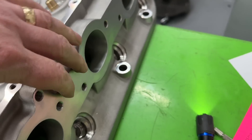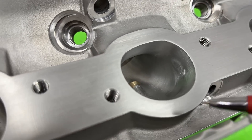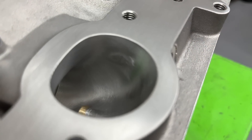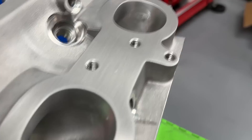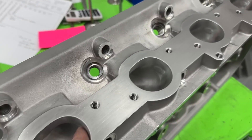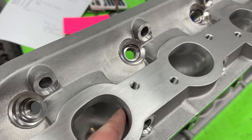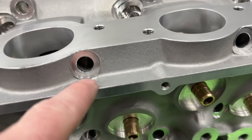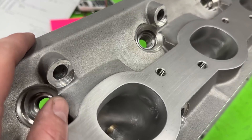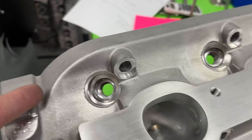The same thing happens on the exhaust side - there's a bolt hole right here with a bump. In all fairness, whenever I'm grinding these I can make it perfectly flat. It might blister a little bit - what I mean by blister is it's not really broken through, but if you shine a light through the head bolt hole you'll see the aluminum is moved over, it's thin. That does not hurt. Same thing with the head bolt hole on the intake - it does not hurt if you break through.